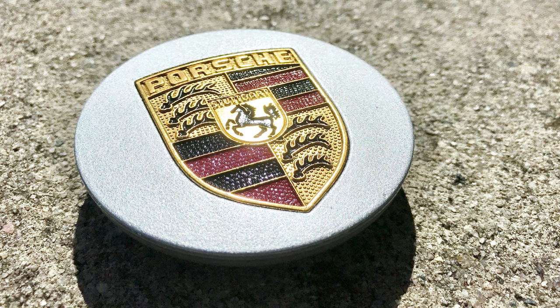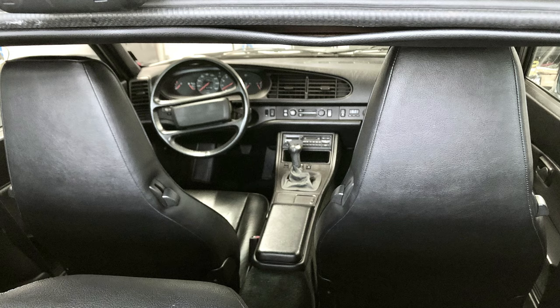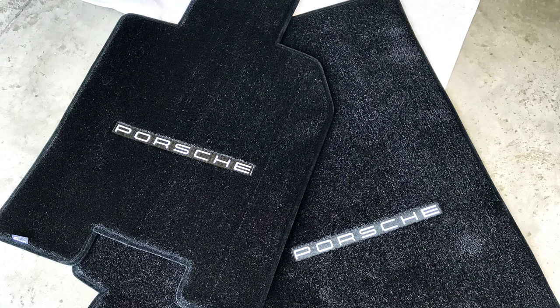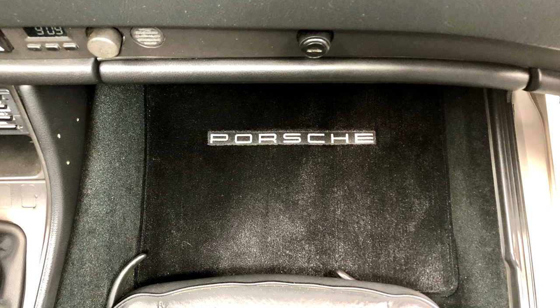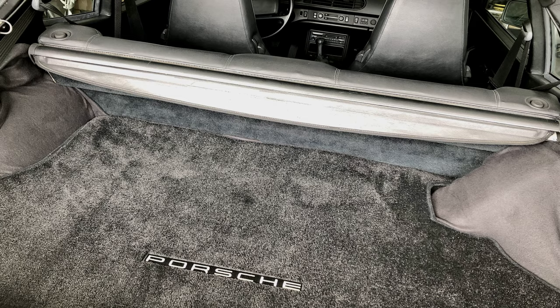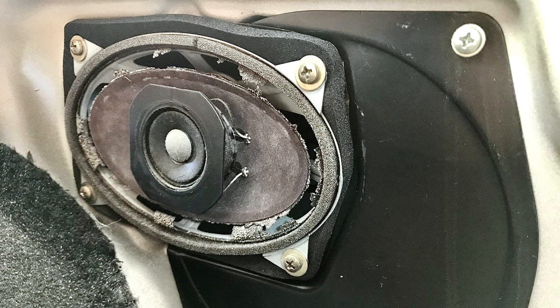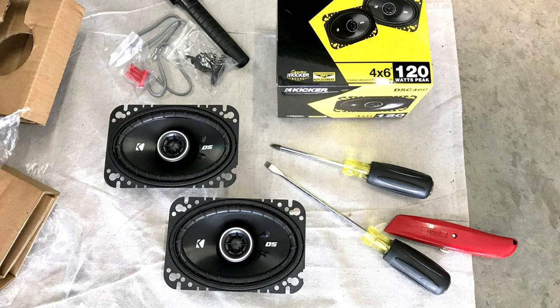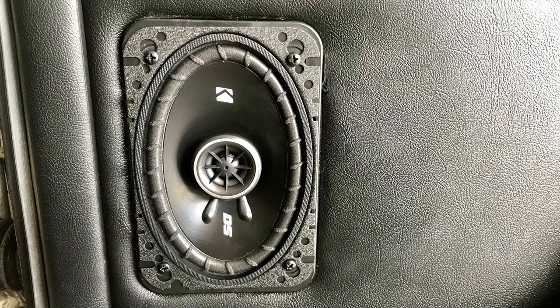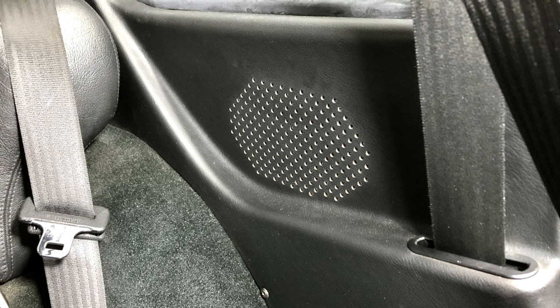The exterior costs for year two totaled $333.92. For the interior, I continued replacing missing screws as discovered and re-glued a section of the sagging vinyl headliner strip by the third brake light in the cargo area, along with some carpet separation by the passenger door for a total of $6. Larger expenses included replacing the front and rear floor mats with the Porsche 944 Ultimate Black Series by Lloyd Mats for $153 and the rear cargo deck mat with Porsche script for $170, both of which dramatically improved the interior appearance. The foam surrounds on the factory stereo speakers had completely deteriorated, so I replaced the front and rear speakers with Kicker DSC-46 4-inch by 6-inch two-way car speakers for $90. I timed this repair with the quarter window seal replacements, because the rear windows need to be out in order to safely remove the interior trim panels that cover the rear speakers.